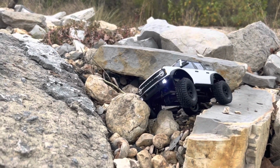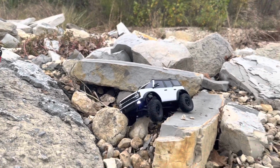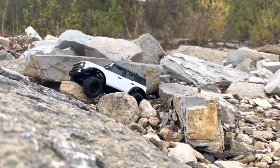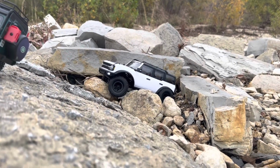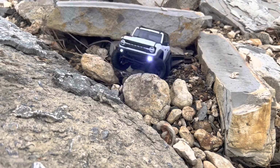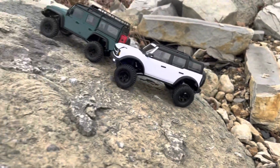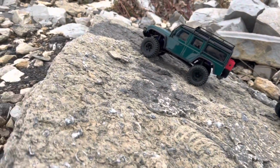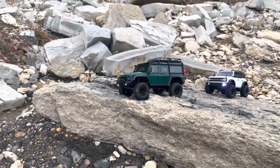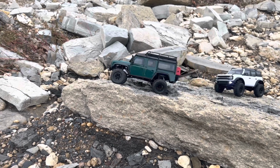So, by the way, if you run a 43, most of the Endura 43 millimeter shocks, that's what I run, they extend to 43 millimeters and collapse down to basically the same within half a millimeter as a stock shock. So you're gaining, you actually have 21 millimeters of travel versus 10, or maybe 13. But they handle so good.